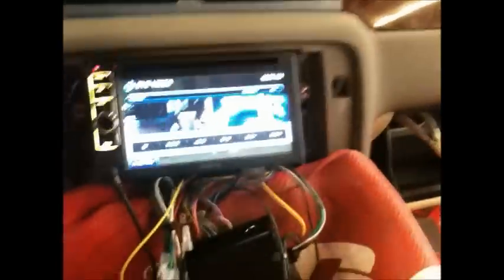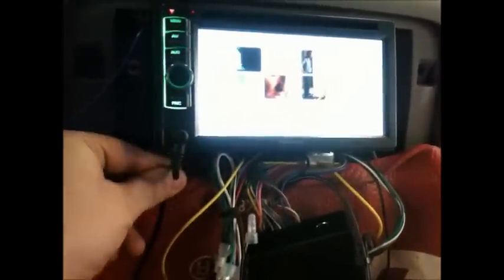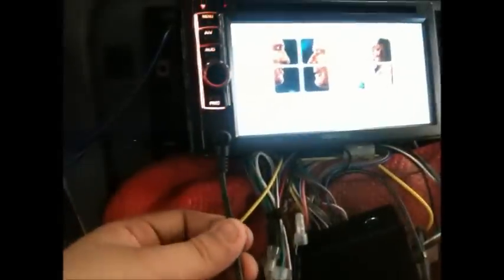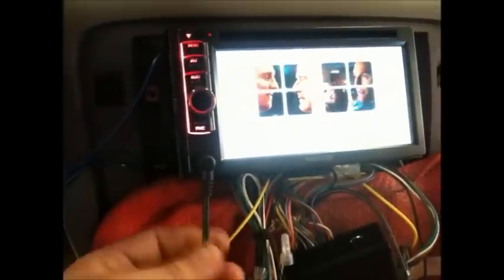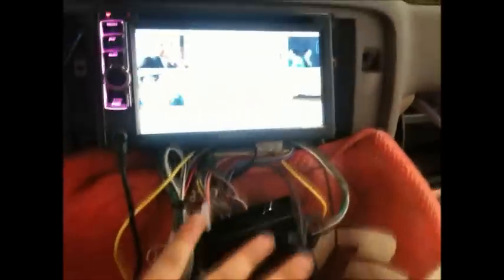Yes, sir. Alrighty, well, let's continue it off, guys. We just got the head unit's already done. We just gotta mock it up, and then we gotta make this look nice and clean coming out of the kit. We're gonna go ahead and use a special diamond blade. It's gonna make just enough of an opening for us to pass the wire between the AC and the actual radio kit bezel. So let's go ahead and get that done, and then find a place for this.